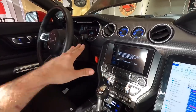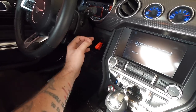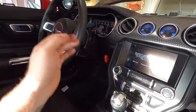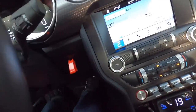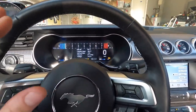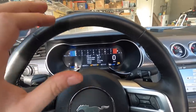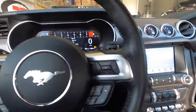So we do our burnout, go up and stage at the lights — on the way to lights we just toggle this switch. It's tied in between the pedal activation wire. The idea is to work with the foot brake. We can change this wire to make it work off of the transbrake using paddles — we may toy with that in the future. But we need to be leaving under boost, and this should be the magic ticket. Playing around with the settings, I think we got it figured out. The switch is in the on position, I'm in drag mode, ABS and everything is turned off. What it was doing before was the engine would go into limp mode — misfiring, blub blub blub, all crazy.